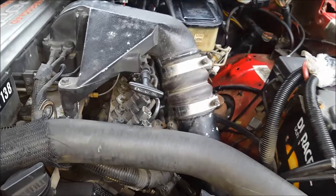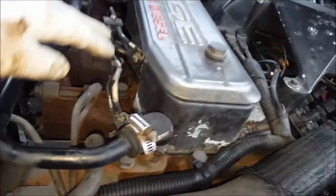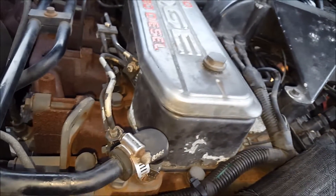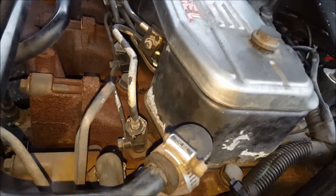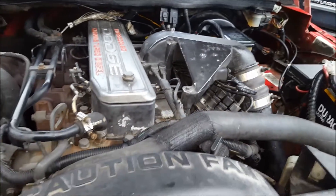Why don't you want air in your diesel? Look at these high pressure lines going out to the injectors. If you get diesel that has air in those lines, air can be compressed and you're going to be losing pressure. Liquid can't be compressed — so when these things are shooting out at their prescribed pressure, you get that nice diesel spray into the cylinders. If you get air in the system, it's not good for the pump, and it's not good for power or efficiency.